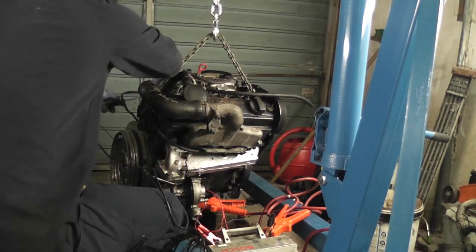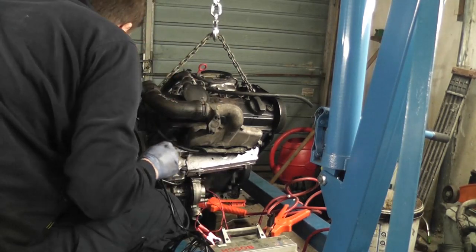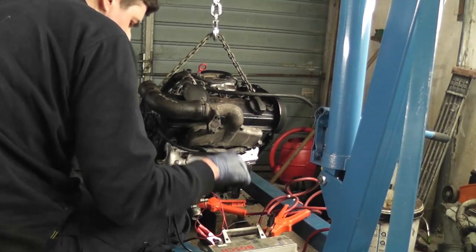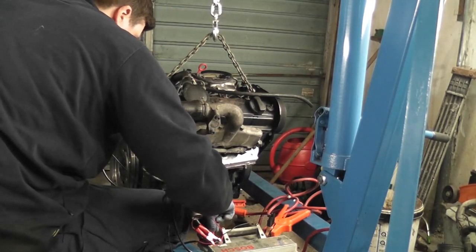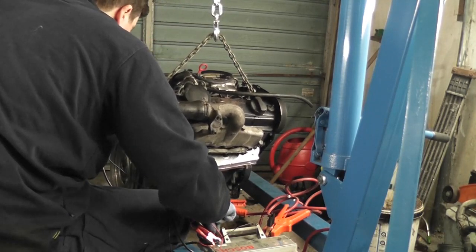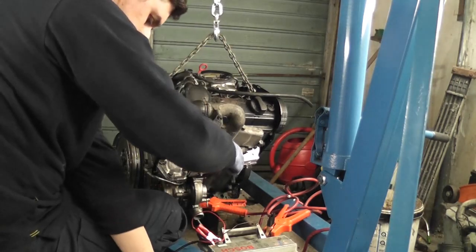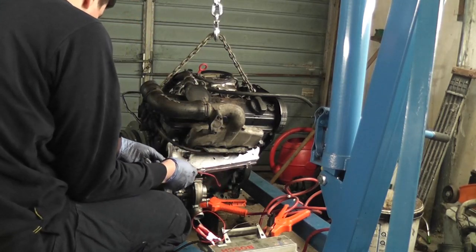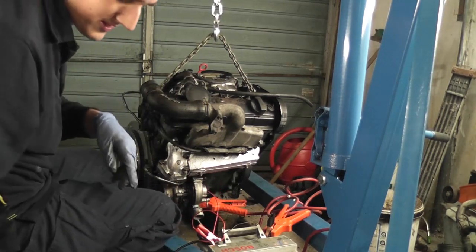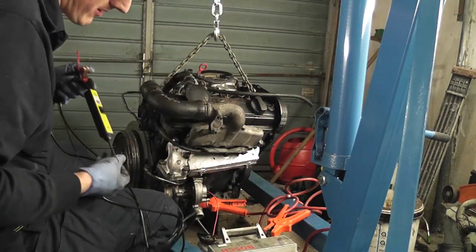And check, there's another oil pressure connection down here. That one doesn't seem to be working actually. Right. Okay, so it's cranking over now. So maybe we're getting there. I still don't trust that auto test probe in this instance, simply because I think what's happening is the engine's drawing too much current from the battery and it's taking the power away from this and it's not working.